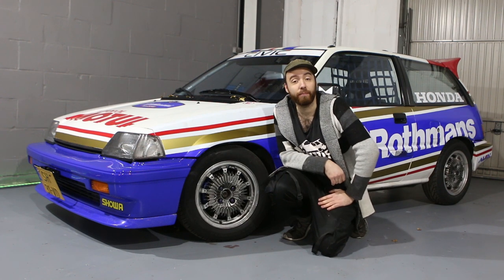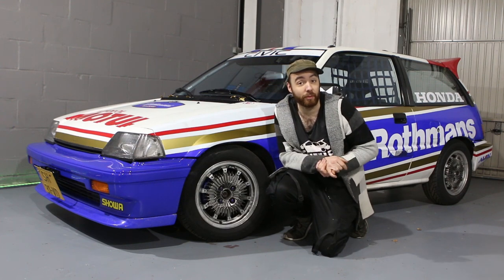I was hoping for a 10% improvement in braking distance. I just finished the Braking Tests Mk2 and I noticed something interesting. These white lines are the five brake points I had with the new brakes. And here you can still see yellow lines — the yellow brake marks were all over the place. But once I did the brake test with the new brakes, shown by the white lines, it's very contained — within about one meter. So that is very interesting and I did not expect that result, but it kind of makes sense.